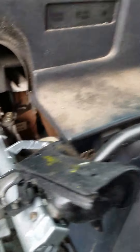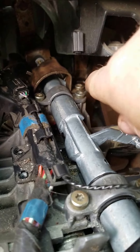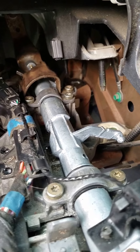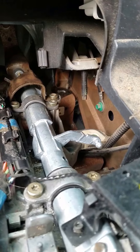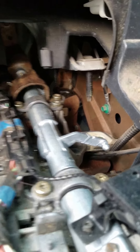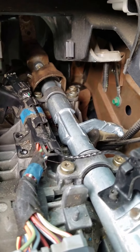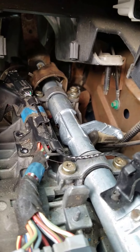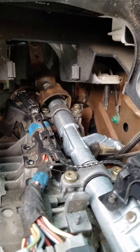To get this lower clamp back on, you have to pull the shifter back to release the spring tension so you can get it into position — you're going to really fight it if you don't. The cable was hand pressure to remove, and once you're ready to put it back on, it just snaps back into place on that lower arm. Then put your clamps on.